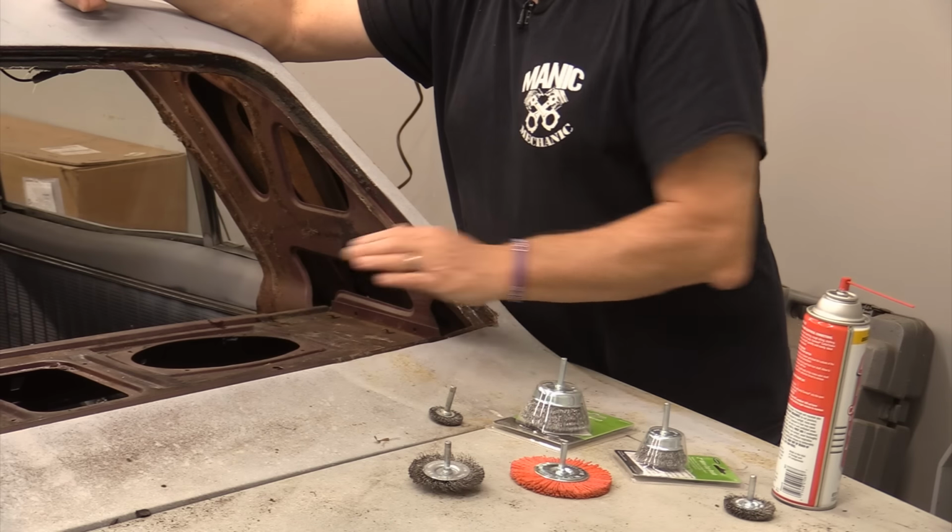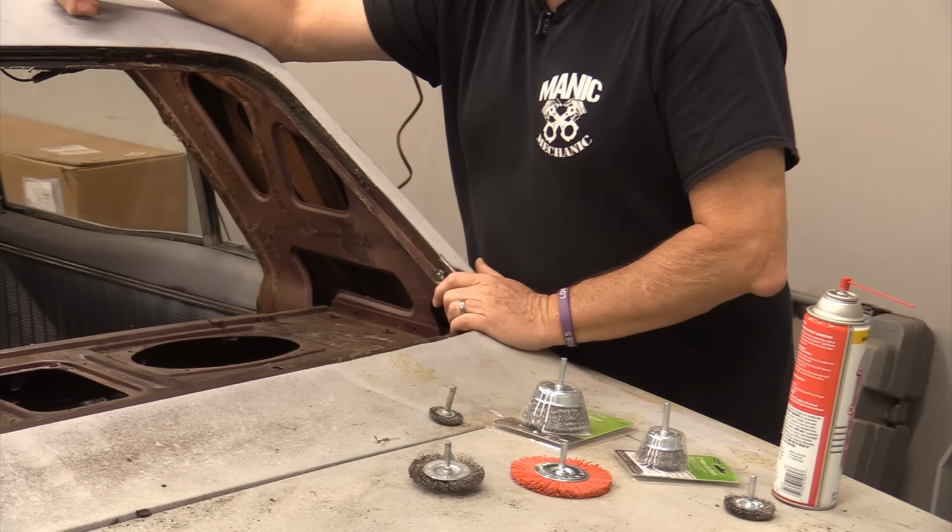All right, we got the metal welded in. Now we need to figure out a way to seal it up so we don't get any drips inside of the car to affect the package tray in the back of it, because any window problems you have back here, if water gets in, it's either gonna go down into the wheel wells and cause a problem back there, or it's gonna cause a problem in your package tray, and the package tray falls out and your car falls apart